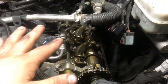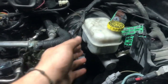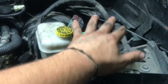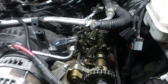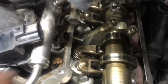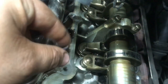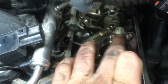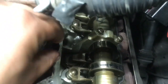I got the valve cover off — had to do a lot of work. I had to remove the brake booster, which is kind of loose right here, and move this bracket that holds the fuse box in place. What I had to do was actually turn the engine over. Check this out — like I said, this is the valve spring that's messed up. I turned the engine over so the lobes won't be pressing down on the rocker.